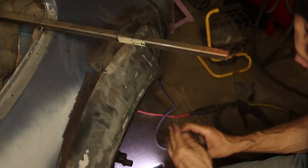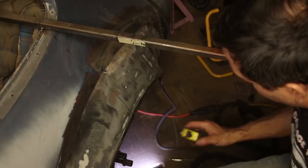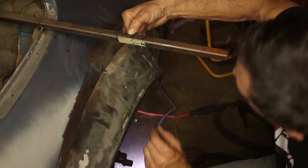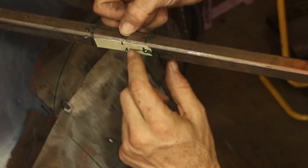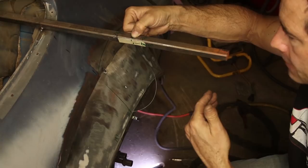The other measurement is the distance in and out — the clearance to the wheel — and that's what the plumb bob is for. The plumb bob is dangling. Here's the target line right about there, and it is about a millimeter too far in. So I will cut this tack weld, shift it out a millimeter, and then do the final trim at the top so that everything is in the correct place. It's much easier the second time around.